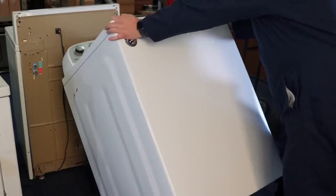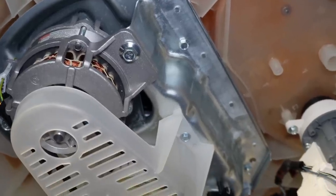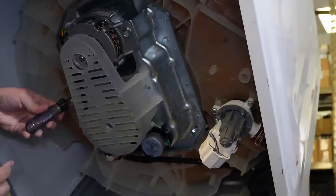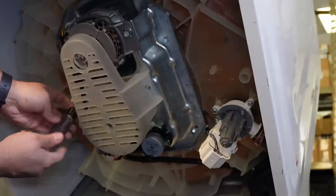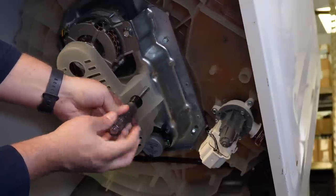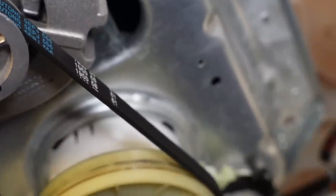The filters are totally clogged. When I take them out, you can see they're really in bad shape and hot water probably wouldn't even run through this machine if we tried. Now let's tilt the unit rearward and look underneath for any clues on damage. Overall, this unit actually seems in good shape underneath, but there is a cover I'm going to remove with my 11-in-1 screwdriver to reveal the pulley system. It looks like everything underneath the cover is in good shape.